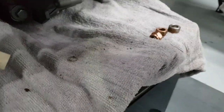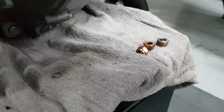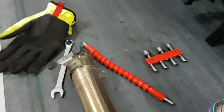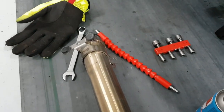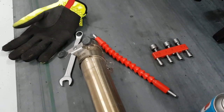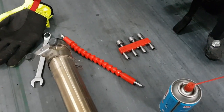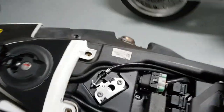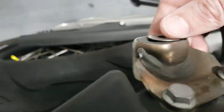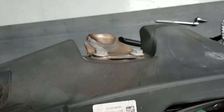We're going to add some copper slip to the threads for later. We're going to take whatever spare parts we can send to be ceramic coated — we'll high-heat coat those in the meantime, such as the nuts, the brackets, threads, whatever else there is, as well as the bracket that holds the muffler or silencer.